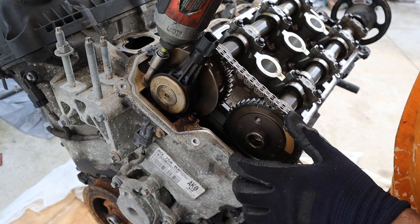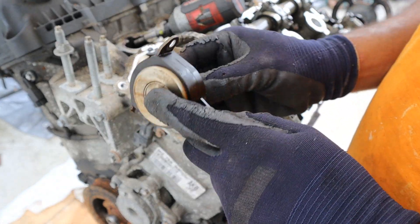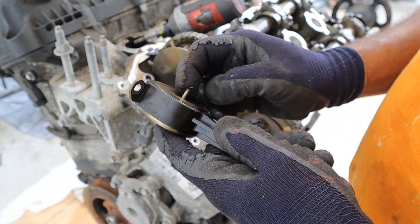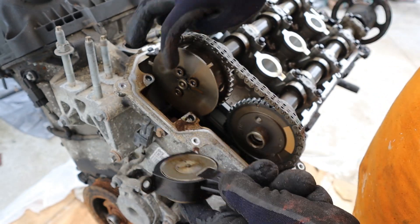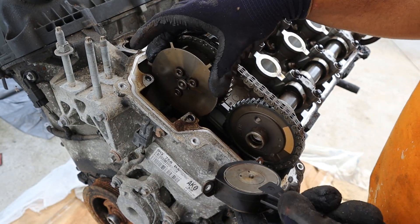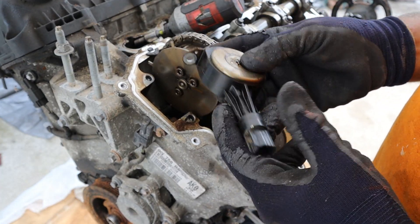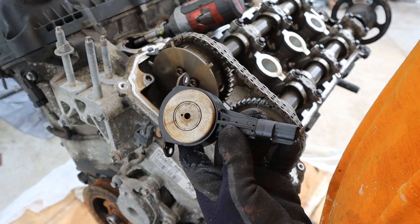This is the oil control valve, which I'm going to remove. It's got a giant coil in here, and that's going to cause this little pin to push out. When it pushes out it's going to push on this tab over here, which is going to fill this thing up with oil in order to do the cam phasing. It's sad that this is internally accessed — you have to remove the valve cover if you need to change this.